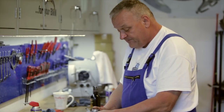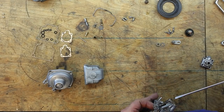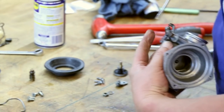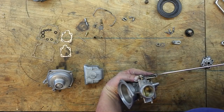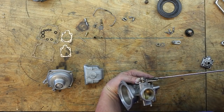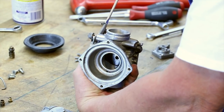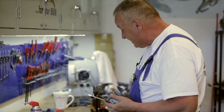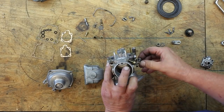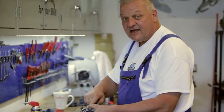Now that that's all sorted out, I'm going to put the adjustment screw back in again. Basically what you want to do is hold the butterfly closed while you screw that screw in. You'll feel when it makes contact — it'll just slightly lift the butterfly off its seat as it gets close. So you just crack it open — that's the base adjustment, just the place to start. We'll get into that later when we tune the bike. What's happening is that this screw is making a stop, not the butterfly touching the throat of the carburetor.